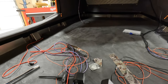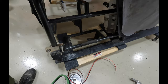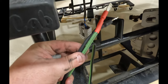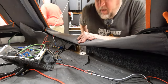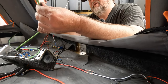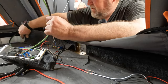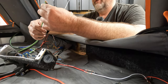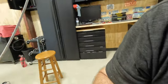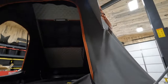Four lights — a touch light under there and two trailer lights powered by the switch — instead of super tiny 22-gauge leads, I'm running bigger gauge wire to carry the amps to those little connectors. Just beefing up wires, adding insulation taping, getting it all ready to put a new mattress over it — secure and waterproof. This little joke of a center wire is now going to be replaced with the proper connector: snap it in and get it going. Now I've got a way bigger cable coming in through the Anderson plug through a nice grommet under the foam.